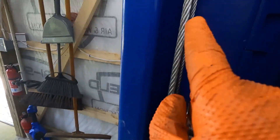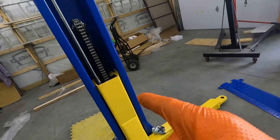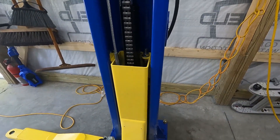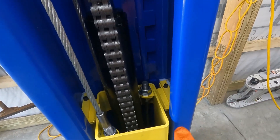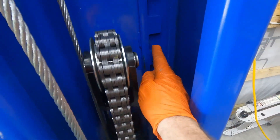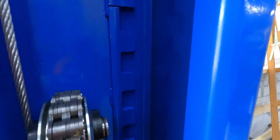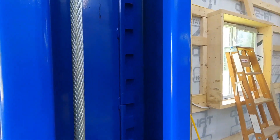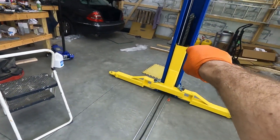The cable goes over the pulley and back down and connects here, so if this one's going faster it will in turn pull this one up — that is how the system remains synchronized, it's just that simple. The directions that came with the lift say tighten the one that goes clack first, because we've got this piece of metal in the back here with these notches in it — that's where the safety latches go. As the thing raises, it goes clack clack clack as it goes through those notches, and the same is happening on the other side. The side which is going the fastest is going to hit the next notch first.